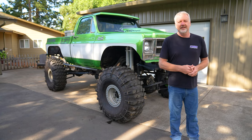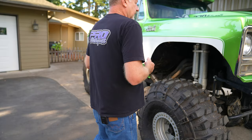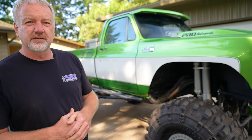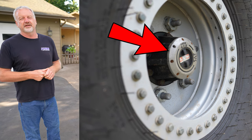So this is where it is as of today. What we've got is a '76 GMC square body, two-and-a-half ton with Rockwells under it. It's got chromoly axles and spools both ends. On the driver's side I put a manual hub on it so I could disengage the front so it doesn't tear everything up when you're driving across lawns and stuff like that.